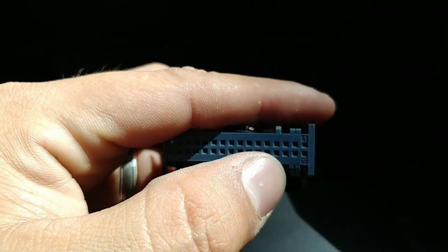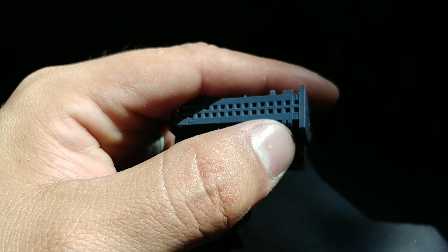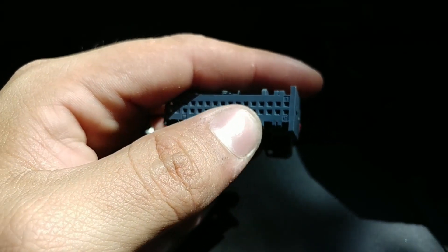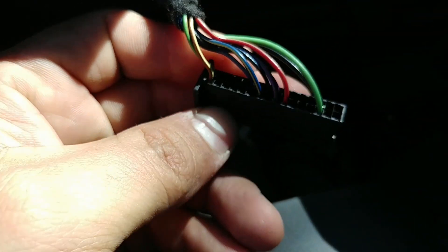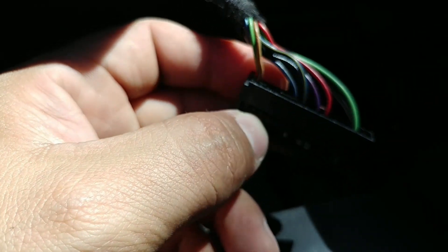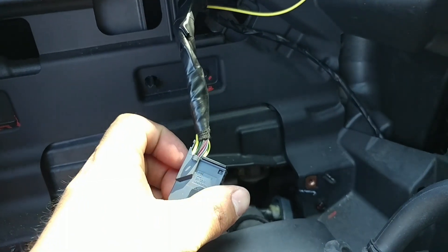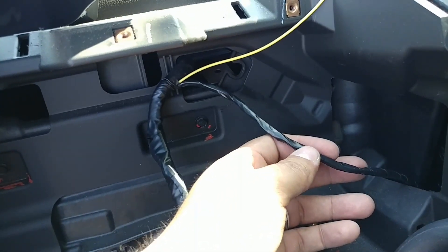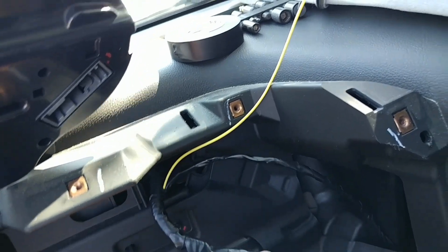You can see pin 1 is on the top right, going left from there. We're going to tap those four — pins 1, 2, 17, and 18 — and then pin 5 is down here on top. You can confirm that pins 1, 2, 17, and 18 don't have wires, pin 3 does, and pins 4 and 5 don't. I got all my wires in there, put the gray piece back in place, and everything slides in nice and smooth. That's five to six wires going into my radio harness and one wire going to my steering wheel harness.